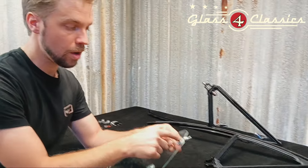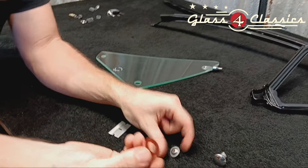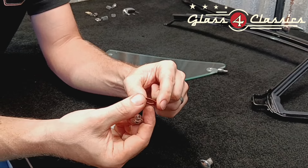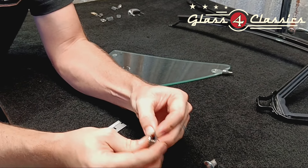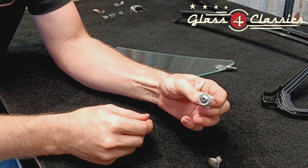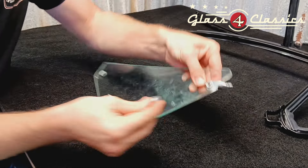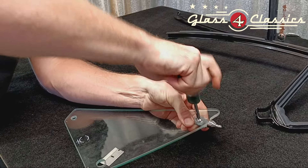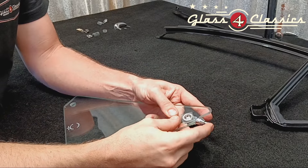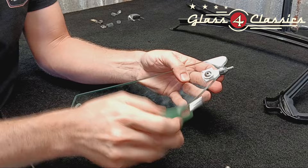The other thing we do — there's nothing on the outside of this; it does sit flat on the glass. They did originally have a fibre washer on them. You can find sometimes the fibre washers aren't always the right size or diameter. We use the same irrigation pipe — I've just pre-cut this oversize, put a hole through the middle, push that through. We're going to come through, remembering there is a left and a right to these and they go on the outside face of the glass. Grab our screwdriver and tighten this up. When you tighten this, you still need to have a little bit of movement through here because you need to line it up inside the actual frame itself. Get this about 80 or 90%.